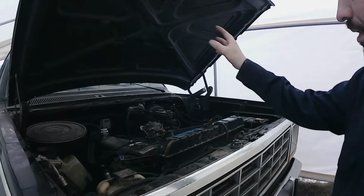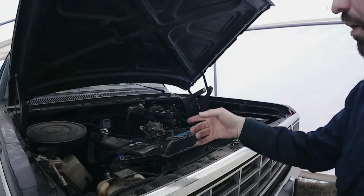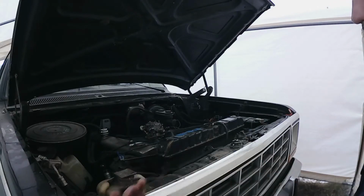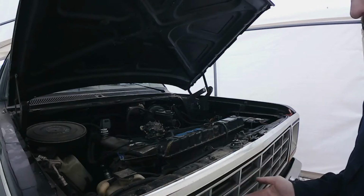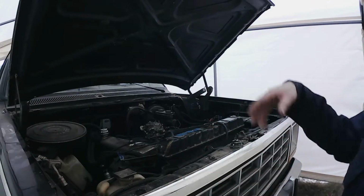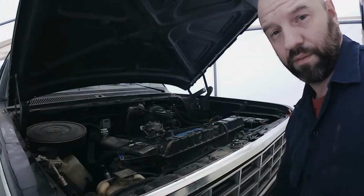Okay, it's warming up. You see a little smoke in here just because the oil's drained everywhere. It's just sat. The other thing, my automatic transmission, the poor old 904, it leaks. I think it sat here and just leaked out all of its fluid. Cycled it through its gears. It's not attempting to go into gear, even though I left it in neutral to pump it, because a TorqueFlite pumps only in neutral, not in park. So I'm going to get some transmission fluid down in there, and then cycle the transmission, let it pick up all of its fluid, and then make sure it's in good operating order too while I'm tinkering around with it.